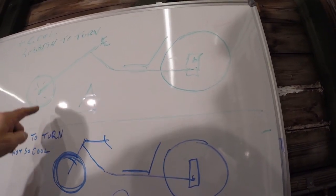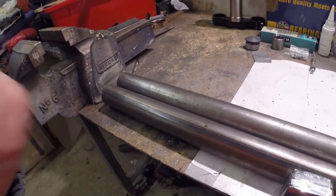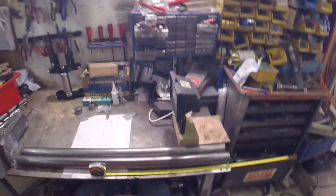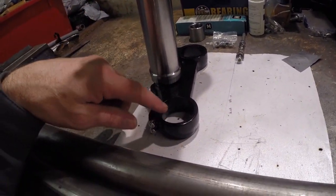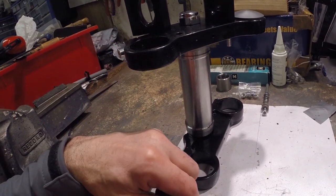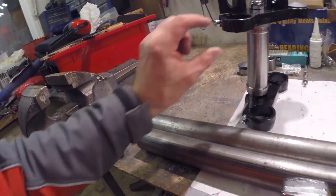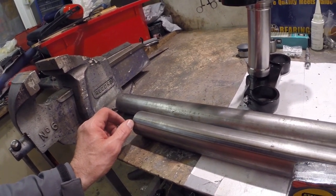What I'm going to do is cut the fork legs long and then see how it looks, because it's a lot easier to cut a bit off than add it on. I've cut myself two bits of tube which were a meter long. The wheel is 26 inch, so the bottom of the wheel will be down there somewhere — already that's quite a length. Now, the bottom yoke diameter matches this tube, but the top yoke has a smaller diameter, so I can't get these tubes through there. So I'm going to slide a piece of smaller pipe down inside, which will let me grip the top and also strengthen the top of the fork leg. We'll add about another inch to them.